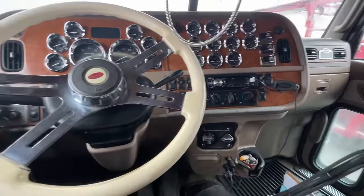Okay. A couple points I want to make on downshifting. When you're downshifting all the gears using the jakes, I almost always turn off the jakes by the time I hit fourth gear, because the lower the gear, the more torque that the jakes are actually putting in. And in anything below fourth gear, it gets really jumpy and kind of hard to control, and the truck's bouncing all over the place. And if I'm coming up to a complete stop, I'll usually engine brake or jake brake within the gears down to about fourth gear, and then clutch in and just brake that extra little distance, like just foot brake the extra distance.